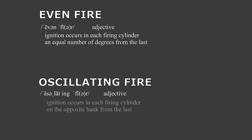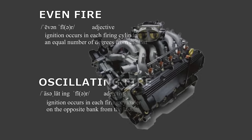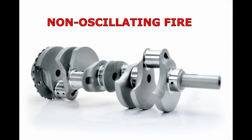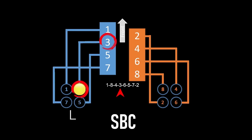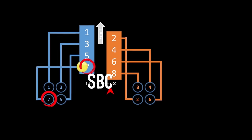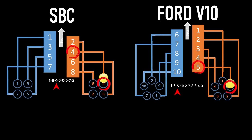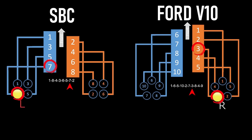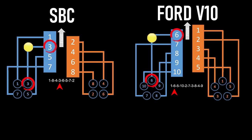Then there is our new term, oscillating fire. We're defining this to mean that the firing order oscillates from bank to bank. The Ford V10 checks both of these boxes. A cross-plane V8 is non-oscillating fire. A small block Chevy, for example, will fire left, right, right, left, right, left, left, right. The Ford V10 is oscillating fire. It fires right, left, over and over and over. This allows us to pair the five cylinders of each bank together to get that exotic sound of a Ferrari